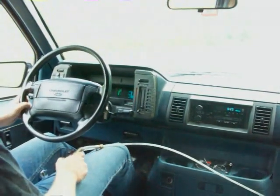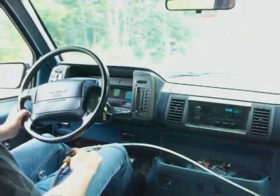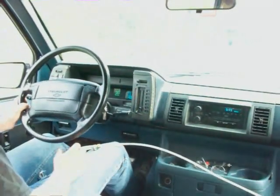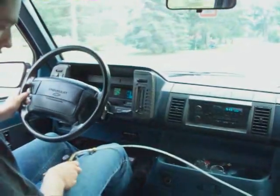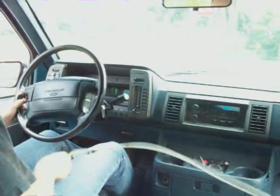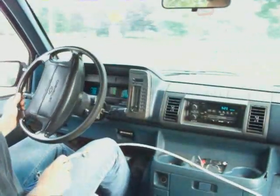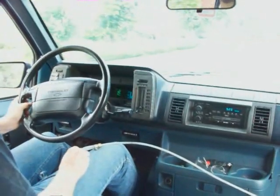You can only give it a little bit of pedal — just a small amount when you're accelerating — because the system does not have enough delivery. I'm going to tilt the tank down a little bit. This tank isn't really full. Am I spraying liquid? No. It did help with the pressure though. I'm feathering the gas by hitting it about a little more than an eighth and back to stabilize the system. I'm laying the tank down — I'm sprinkling liquid propane. No wonder I had more power all of a sudden.